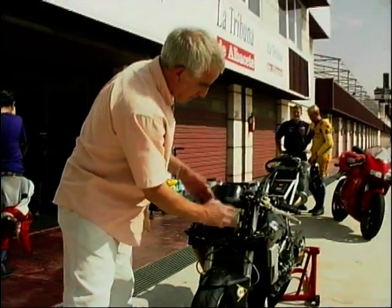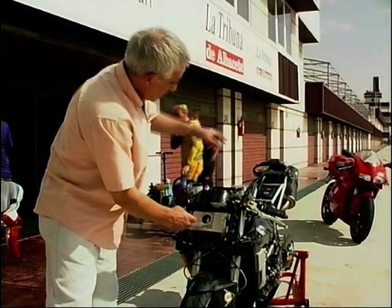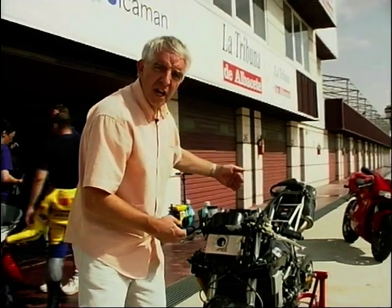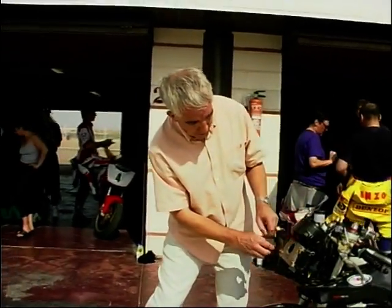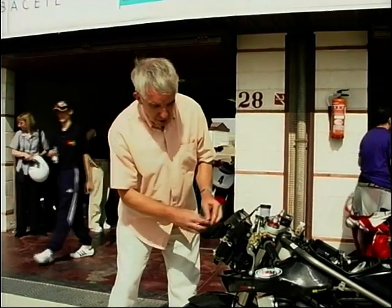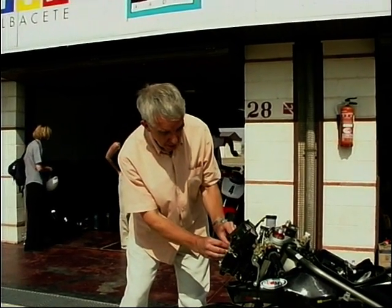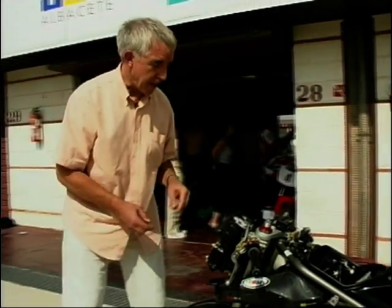Coming up here, one of the biggest differences is the E-Prom — the engine management system. Instead of being up on the tail, it's been brought up to the front end here. It actually saves weight in that they save the weight of the wiring loom going back, would you believe? In there, you've got a little E-Prom plugged in. Instead of the normal way that your dealer would plug his servicing gizmos in to adjust all the ignition timing and the fuel mapping, it's all done from in there with an E-Prom tailored for this particular bike.